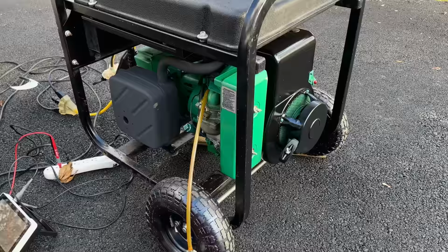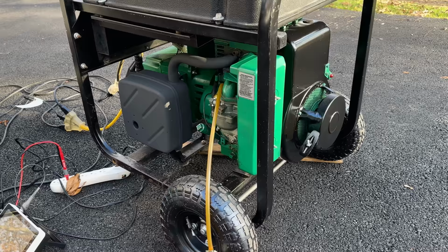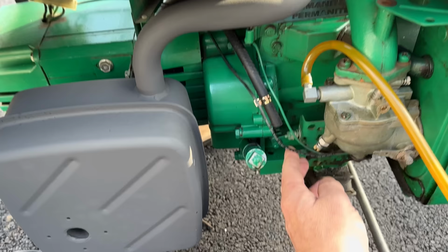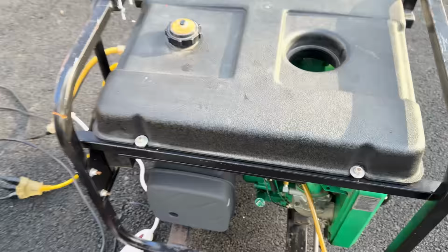Yeah, overall, this old machine did a very good job. It started without issue. The engine continued to sound good, but the engine speed was slow. That is something we didn't check before. It was at 57 hertz, no load, and ideally that would be closer to 61.5 hertz. So we increased the governor tension by turning this knob clockwise and got the engine to about 61 hertz. At that point, the voltage came up as well to 133 volts, which is high, but for something like this, it's not unusual.